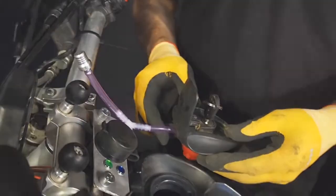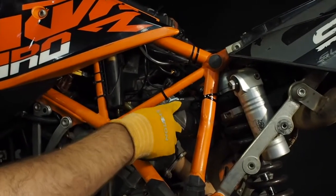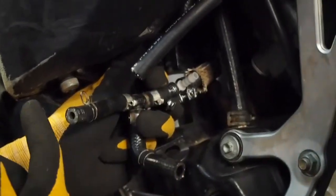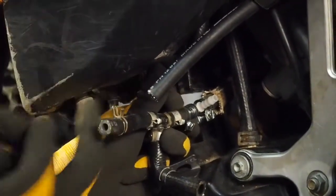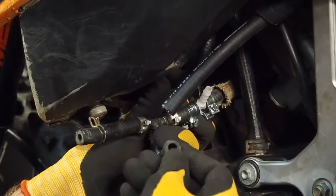Here you use the white Y connector and connect it like this — here is the vent cup and it goes to the original outflow from the tank. Now the final stage: connecting the auxiliary tank with the front tank. You have the fuel line ready here — put the petcock here, take the tube up to the front, use the protection tube again. To make it easier, the OEM tank has a connection tube. Here is the OEM petcock and here is the hidden OEM fuel pump — take out the tube from the OEM fuel pump intake.